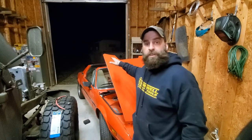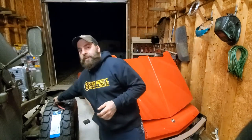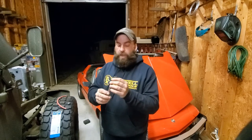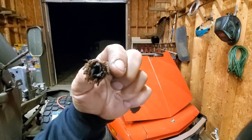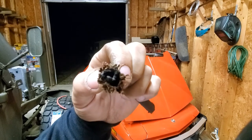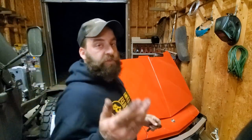And that's when I found something that I missed on the initial inspection — the brake hoses themselves that go from the master cylinder reservoir to the master cylinder. One thing about this car: it has a remote master cylinder. The master cylinder is underneath the dash, but that black cap right there on that white container is your brake fluid. You have hoses that run from the reservoir all the way across the cowl, and then it goes down into the dash and hooks to the master cylinder. So I disconnected those hoses and got a look at them. This is the old style hose — it's a rubber hose, silicone base with a cloth coating over it — and they have completely come apart. You can see there, they are just absolutely terrible, and when you squeeze it together it doesn't even really want to open back up. It's just falling apart, and this was causing chunks to clog up the hole, so fluid actually wasn't making it to the reservoir.